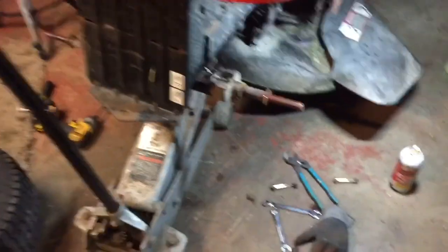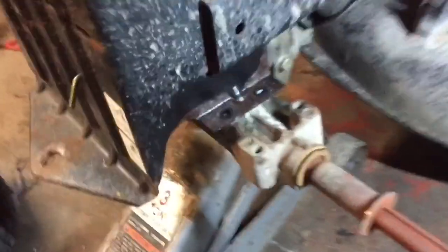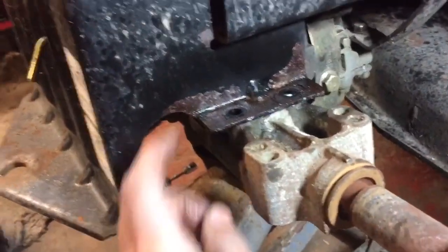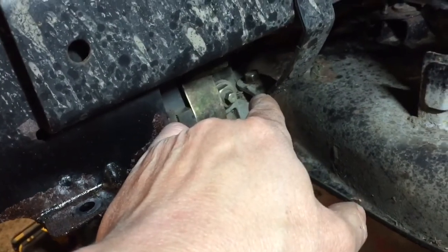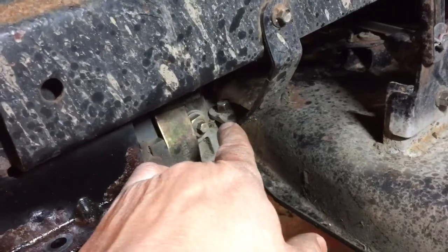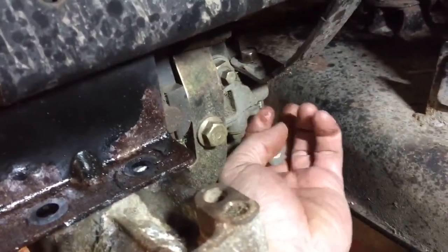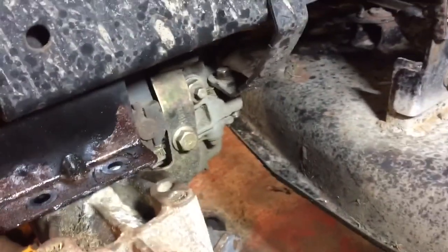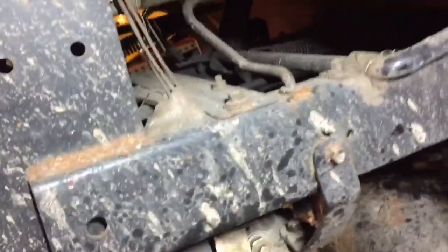So my axle removal process so far is I got this up on my gambrel hooked up there and a jack holding the tranny on. Two 13 millimeter bolts coming up through here. And then on this side, it's a little different than the other side. Kind of holding this bracket on, there's a bolt drops down from the top with a nut, 13 mil also. So take that bracket off and see what else is hooked up to the tranny under there.